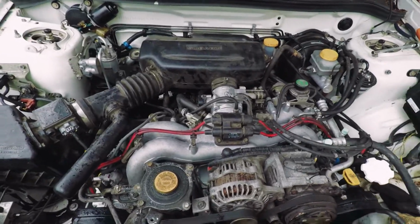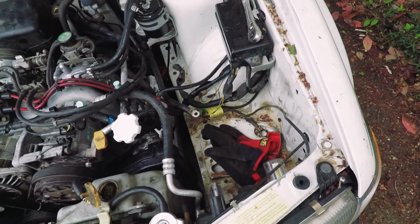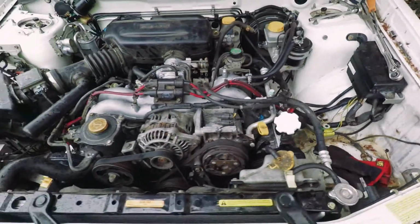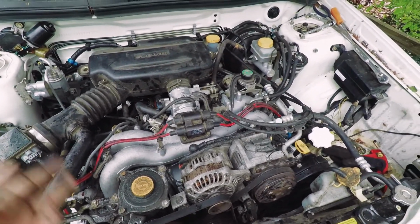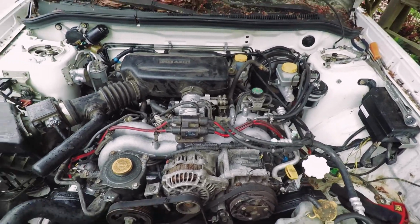Alright guys, that about wraps it up for the head gasket video. I'm not going to throw the battery in right now. I have a couple other bits that I robbed off of this car that I need to replace. Also the headers, I didn't show putting those on, but it's just 6 14 mil bolts on the bottom. Just put those on just like how you took them off.